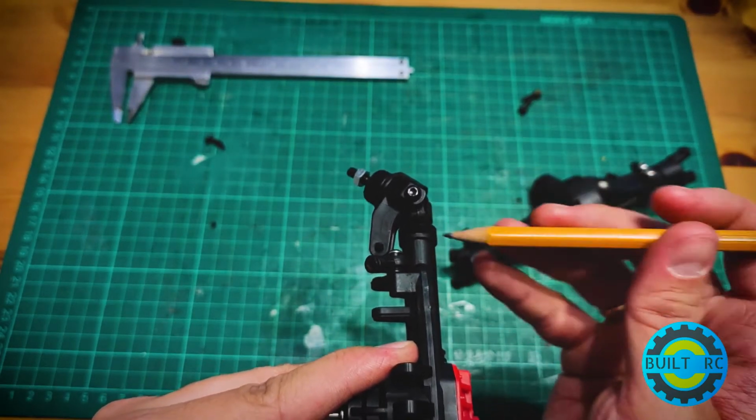So now, as we have this axle housing, right, next step is to drill the hole through the axle. And we will need to mark the hole. To do it, we'll put this off, and we'll measure the distance between the center of the hole and this edge. Well, it's 5.7 millimeters, so almost 6.